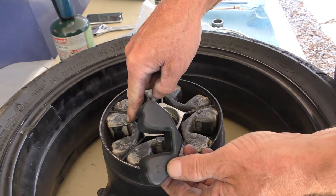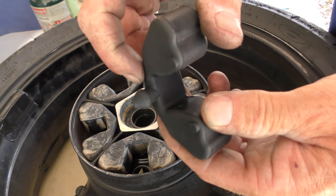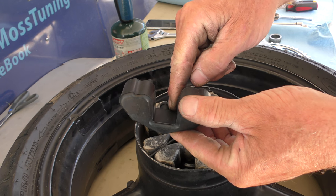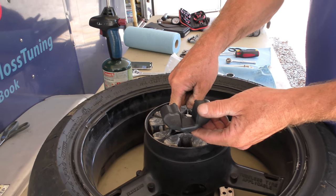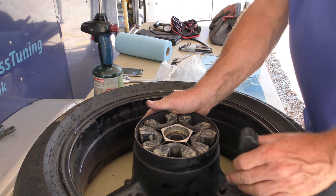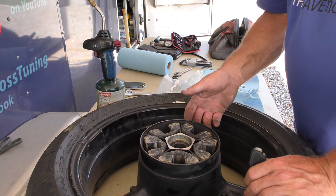So we have replacement rubbers. And you can see they're attached here by a nipple. And that nipple has a groove in it right behind it. It's significantly bigger than the diameter of the rubber before it. So it can be very, very difficult to get these out. The wheel's been in the trailer, it's been cooking, so the metal on the wheel is very nicely warm. If needed, I've got propane, so that we can go ahead and warm up the outside of the wheel to see if that would assist.